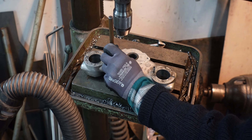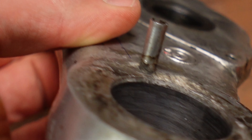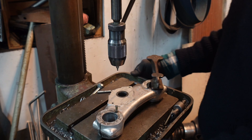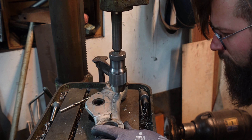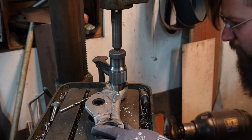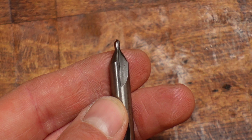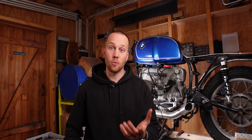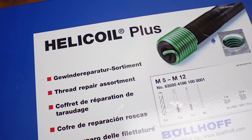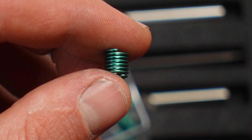I was very happy to be at Nickel's place because he could do the first hole and show me a few tips and tricks along the way. Since the triple clamp is round where the holes are located, we had to make sure to get a solid pilot hole. Using a center drill in the drill press helped a lot, because center drills are designed to first drill a small pilot hole that you can place very precisely, before opening that up to a bigger cone as a start for the proper drill. We also decided to increase the strength of the threads by using Helicoil thread inserts, since aluminum is a relatively soft metal.